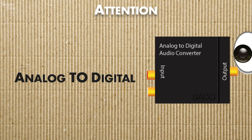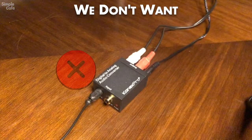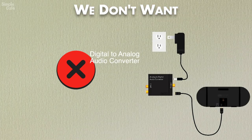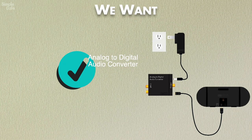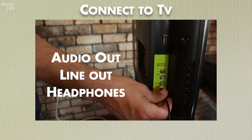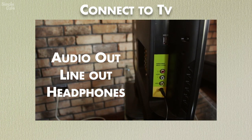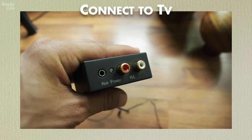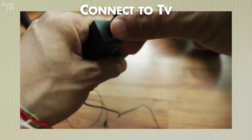Be sure to have a second look because they're very easy to mix up with digital-to-analog converters, which will not work for the analog-to-digital setup we have here. Moving on to your TV — through the audio line out or headphone jack, plug in your aux cable and the other end into the converter's aux port on the input side.